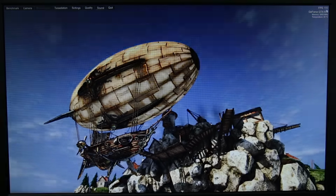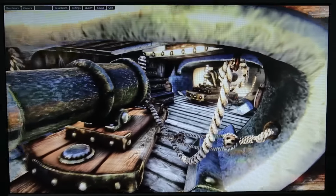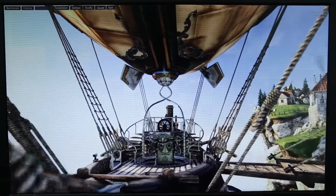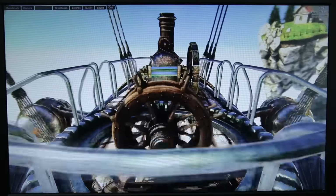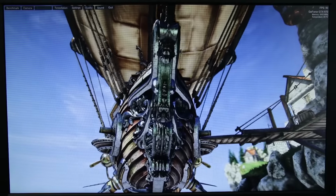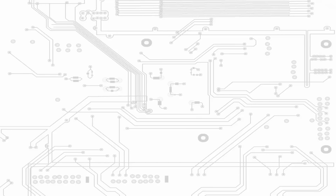But yeah, the FPS, you can see it swings up and down quite a bit when it goes to the max FPS. It's between 110 and 140, just swinging up and down. But other than that, you really can't tell that the CPU is under 100% load while the benchmark is putting the GPU at 100% load. So if we were gonna have any sort of cooling issues, this would be it. I'm gonna let this run for about 20 minutes and then we'll see what happens.